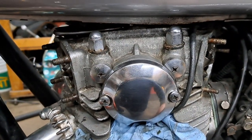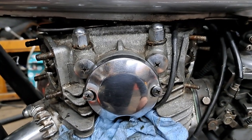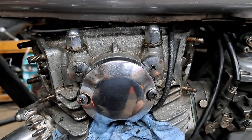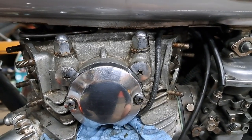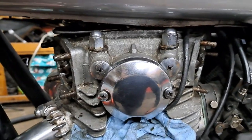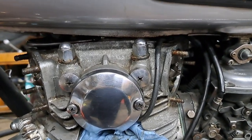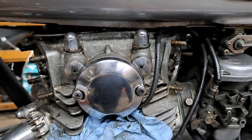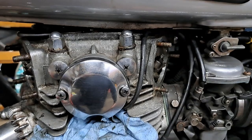So when you see that, if you see exhaust just closing and the intake just opening on any 360-degree twin, you know that the opposite side is the one that you're going to be doing the valve adjustments on first, because that side will be at the top of right on the firing stroke. So valves will be closed. That's where you do your checks. It doesn't work on a 180-degree twin.